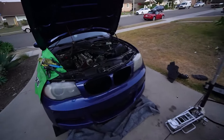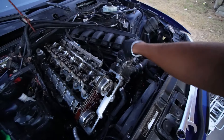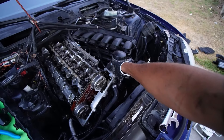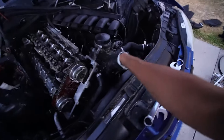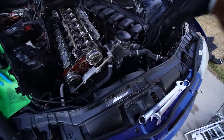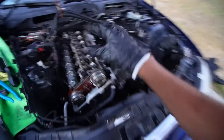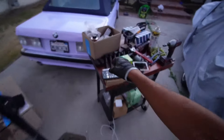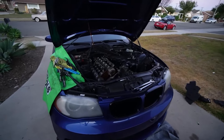We're going to go ahead and get this oil filter housing removed. It's probably going to be kind of gross because it does have this coolant line attached to it. Oh, look at that — it's dry! That is good stuff. I have finished up installing my oil filter housing gasket, and a new sensor which I'm pretty sure is for oil pressure. That would make more sense.